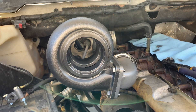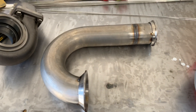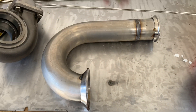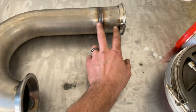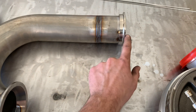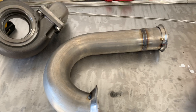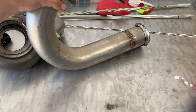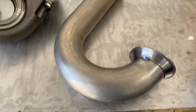Just a simple three-inch U-pipe in stainless. I chopped off part of it and used some of the extra to lengthen the other side. This is the V-band for the turbo — just a three-inch V-band. If I ever do this again, maybe I'd think about going three-and-a-half inch. This looks a little small but we'll see how it works. I'm not going for a million horsepower, just more than stock.